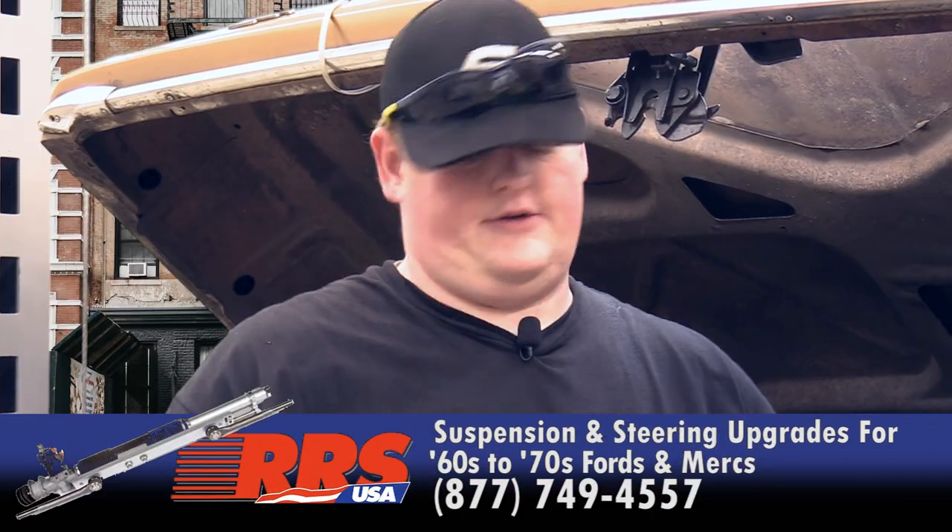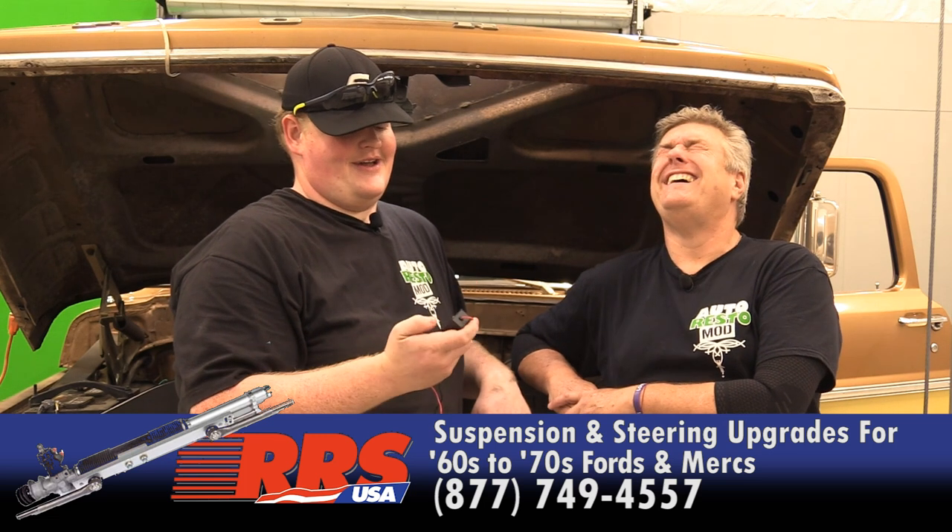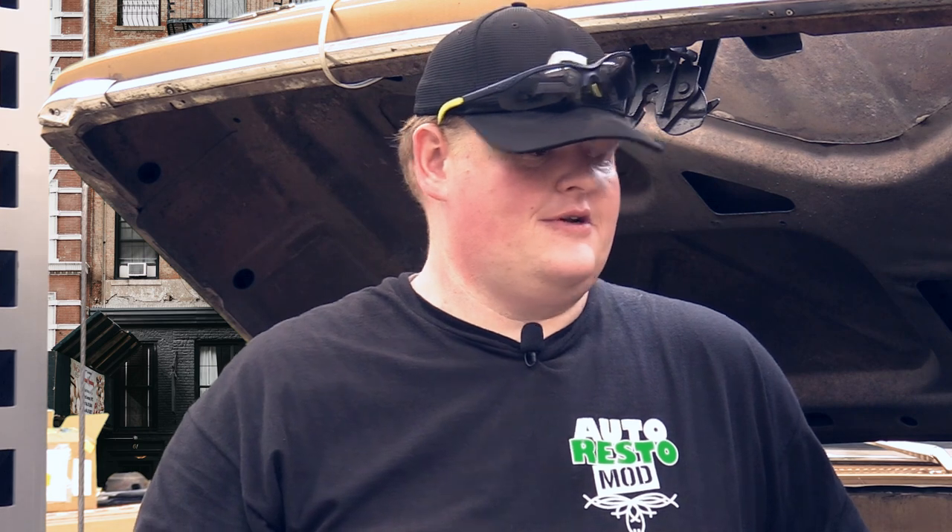I'm a sucker for tools — me too, I've got a lot of bills from them. But this is a nice handy one. Easy to throw in your toolbox, quick to test your gauges, and non-invasive — that's the best part about it. I like that you can just pop the wire off the sender, wire it there, and test the gauge to know you've got an electrical setup right to that gauge. It's stupid simple — basically just a 12-volt load bank. For guys like me who aren't great with multimeters, it's a KISS principle item that's just really nice.